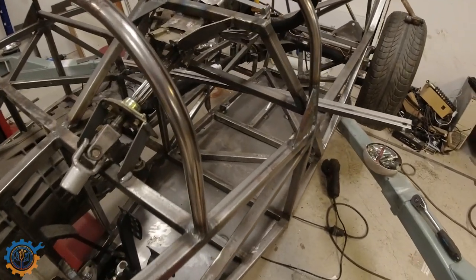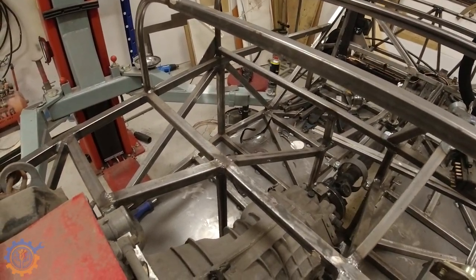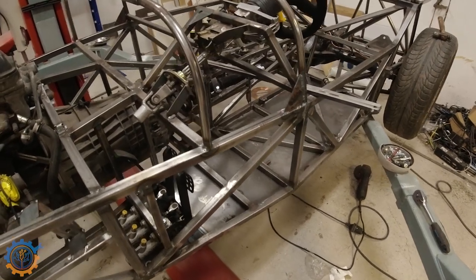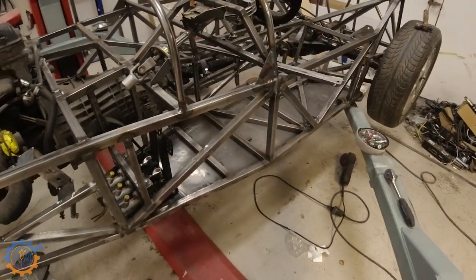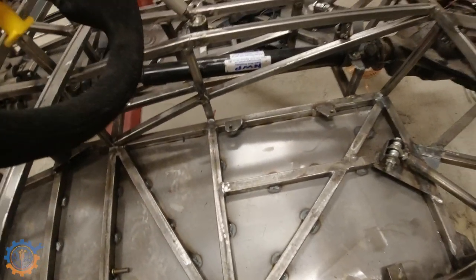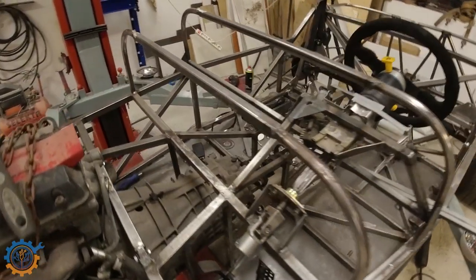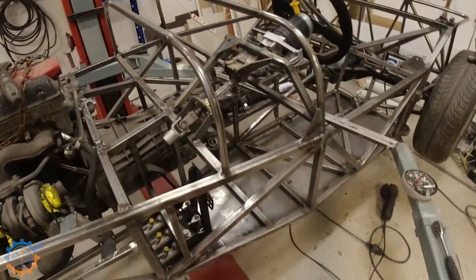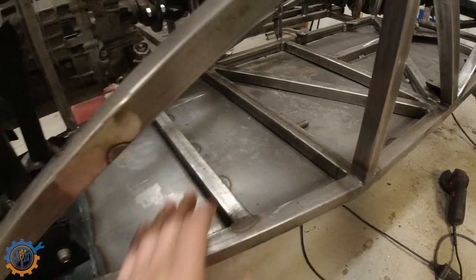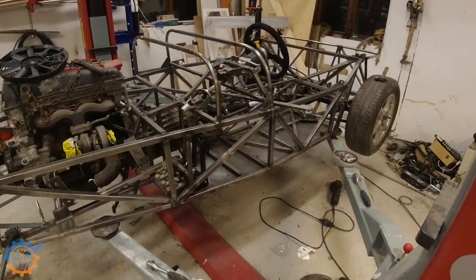The floor as you see here is done with one millimeter normal steel sheet. You may ask why didn't I go for one or two millimeter aluminum instead. The reason is because I had a steel plate at home and I didn't want to rivet everything in place, so I went with this and welded it. I did the weld on the inside to keep it nice and tidy. Afterwards I reminded myself I should have drilled holes into the sheet and spot welded on the underside — that would have looked a lot nicer. But I will have aluminum sheet here for the feet area, so it's not a big deal. Let's get going and start getting the battery box into place, then we'll go for the sheet metal in the floor.